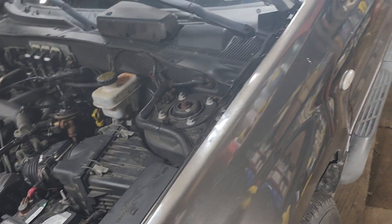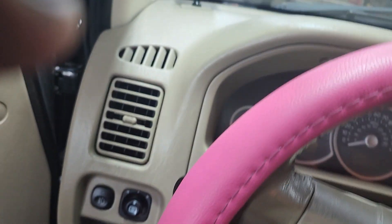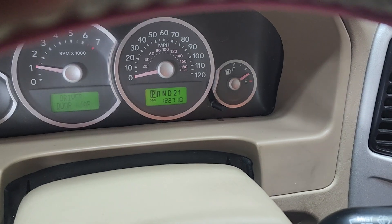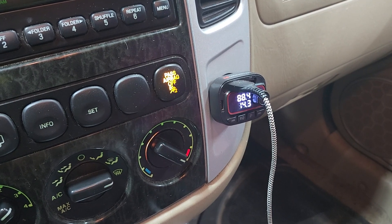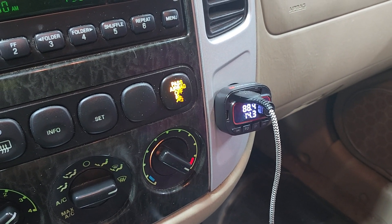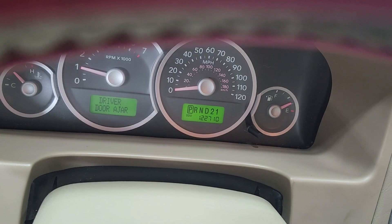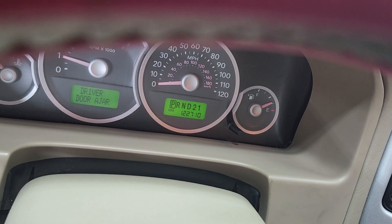All in all, I went through everything, checked all the wiring — wiring's all good, we're getting signal, it's charging at 14.3 volts. It's showing it's charging, it's just that the battery light's on, which I'll show you. It takes about 15 to 20 seconds for it to come on. You can see it's at 12.5 but then the alternator kicks on — boom — there it goes, 14.3, 14.1, 13.8 — it's charging. I ran test leads out of the back of the alternator and it is putting out 14.3 volts.